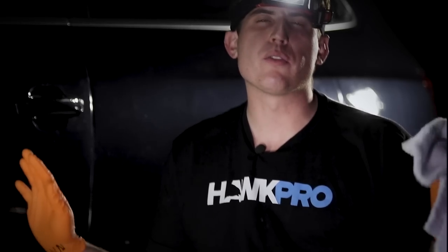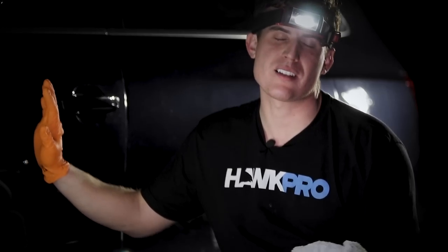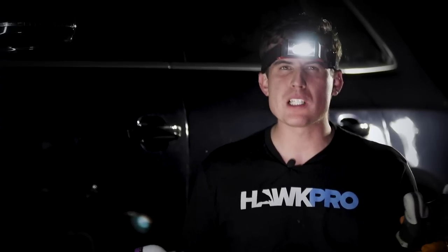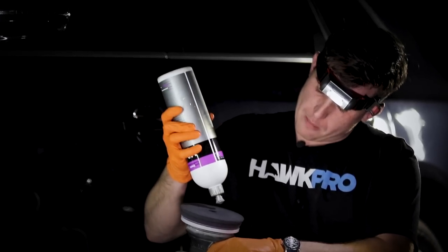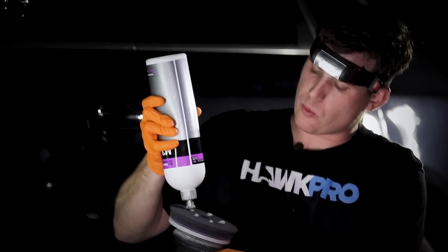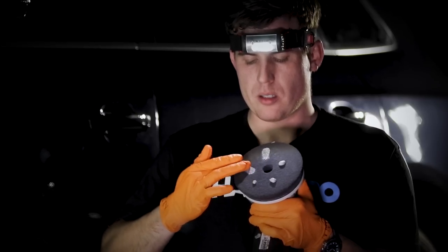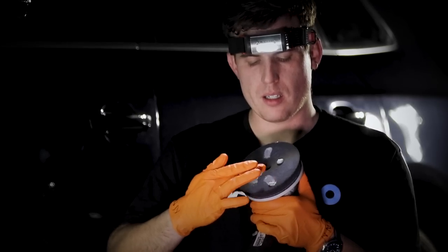One last get out of jail free card, this will work almost no matter what, and it's the way Koch teaches it. I'm gonna teach you the way to basically ensure you're gonna get perfect polished results. It's gonna take a little bit longer than this, but it absolutely works. Check it out. Same basic principle applies. Koch, the way I saw it in their video, they usually do a few drops like around the center. They say to use a butter knife to wipe it in. So I'll just use my gloved hand here.